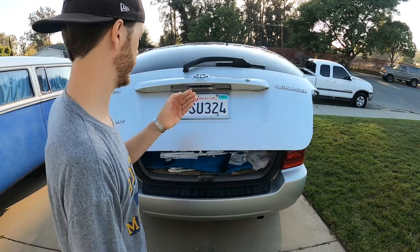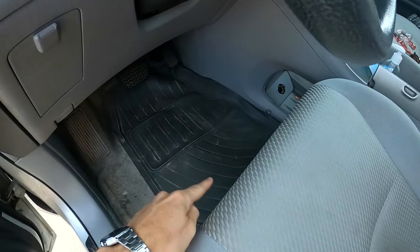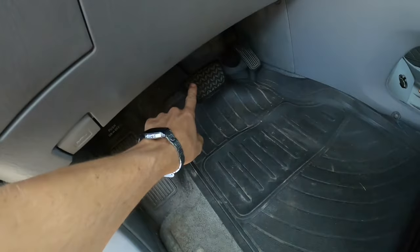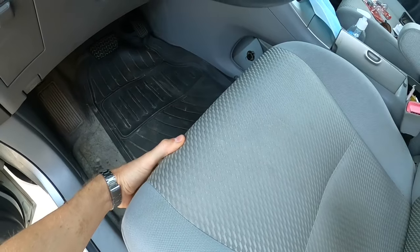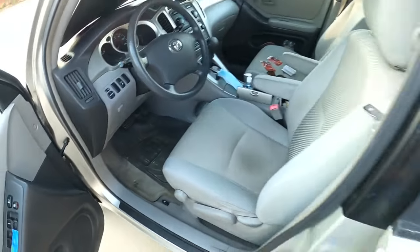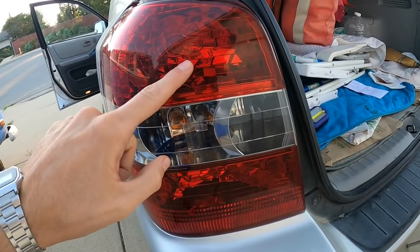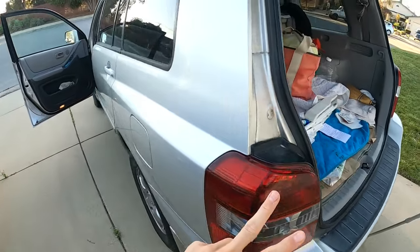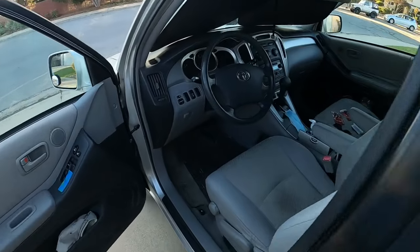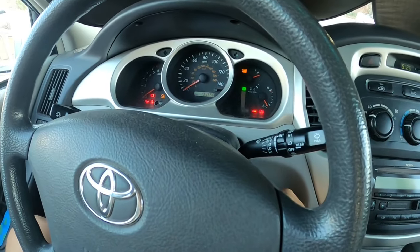Let's get to this one. Go ahead and open the hatch first. If one of your brake lights is out, to check, all you need to do is wedge a stick between your seat and the brake pedal, then move your seat and tighten that up to hold down the brake pedal. That way you can come back and see which brake light is out — there's one here and one here, so there are two on the back.